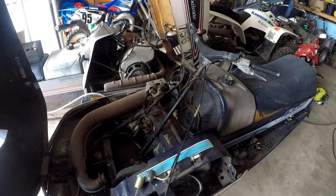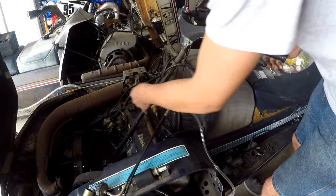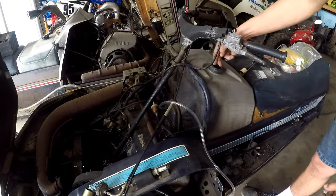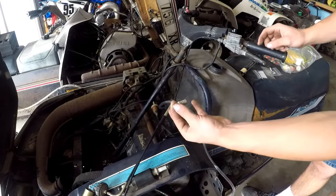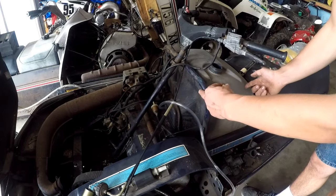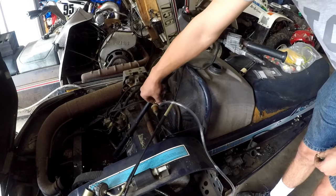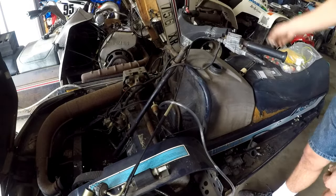We're going to get right into it. I have a quarter inch clear fuel line I also bought off eBay — it was like a dollar a foot, so ten feet was ten bucks. I'll get all my supplies and I will put the new fuel line in, hook my filter on, pull some of the line out so I have the correct amount I want, cut it off, put this on, thread it in, and then I'll be good to go.